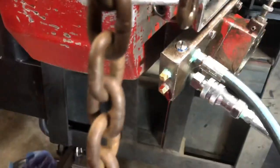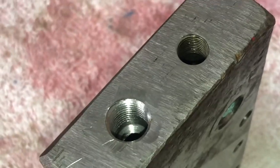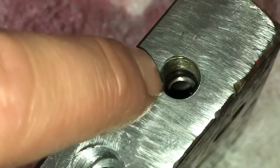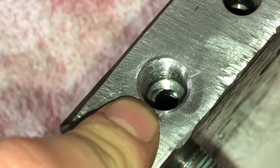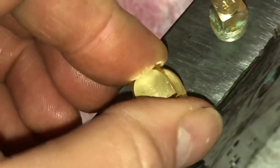Thanks to my dad for helping out — I dropped it off at his house and he has a nice drill press set up. As you can see, this is an eighth-inch pipe thread, that's the original, and where the drill had hit the threads there's just way too much space — the fluid is able to escape. I've got a new fitting here that's a tad bit bigger and it's going to start right at the right spot. I'm going to clean this thing up and get it back together.